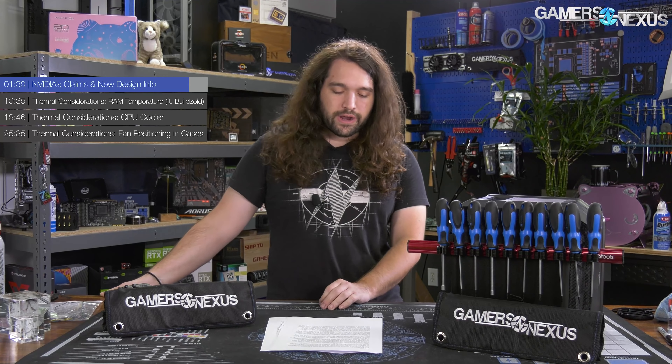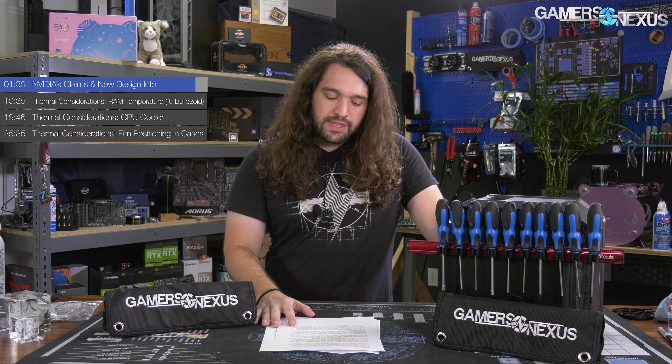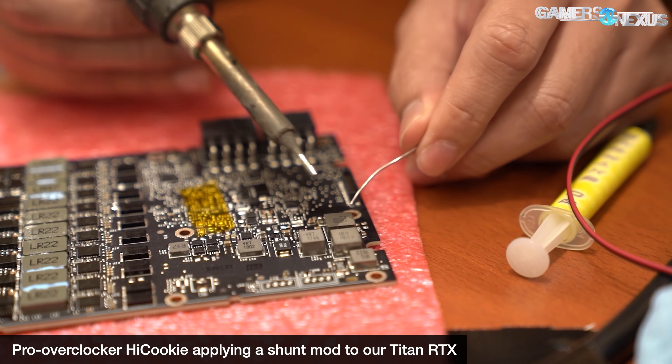We hope to test Ampere's scaling in overclocking livestreams and competitions at launch. We'll definitely be overclocking with the card in its stock configuration and are almost certainly going to be water cooling a 3080 of some kind. Most importantly, we're going to take the Founders Edition card with a liquid nitrogen pot down to whatever temperature we can reach without a cold bug — maybe around minus 125°C, which is where Turing was sitting for the 2080 Ti. NVIDIA has not been too friendly to overclocking, so this will likely require hard mods or BIOS hacks to go further.